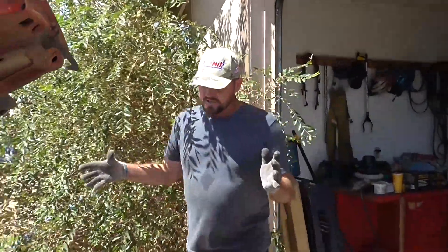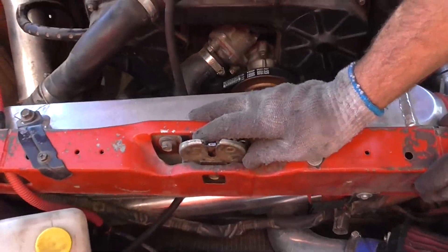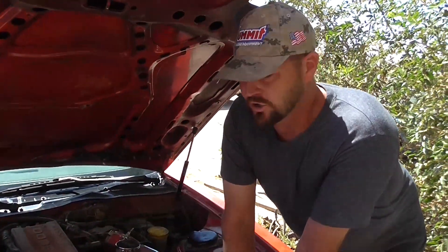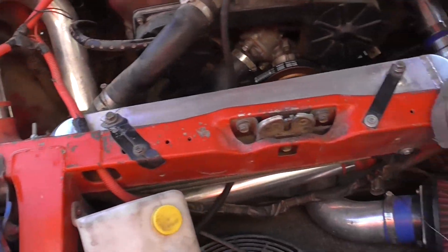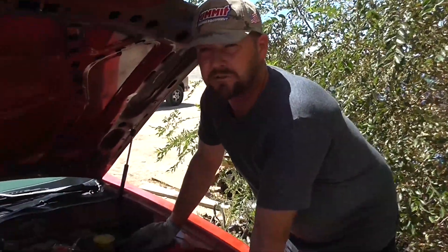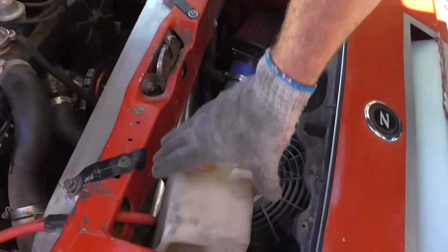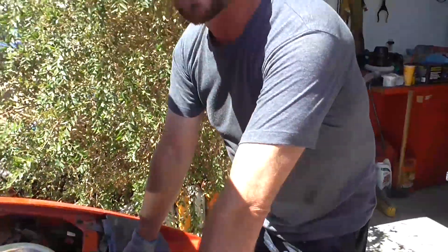I took the approach of putting the intercooler between the engine and the radiator, because I was able to access everything without cutting or making any cuts to the car to put the intercooler tubing in. I was able to fabricate bracketing to hold the intercooler up. But a lot of factory stuff had to be removed or relocated, because the factory right here has all air cleaner boxes and air filters — this whole place is cluttered.